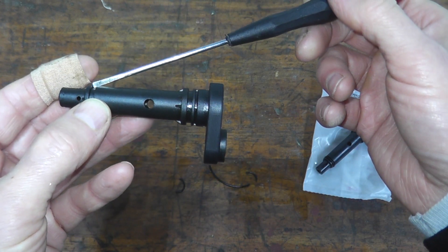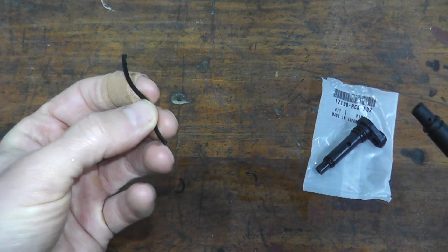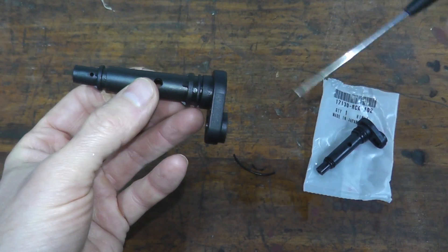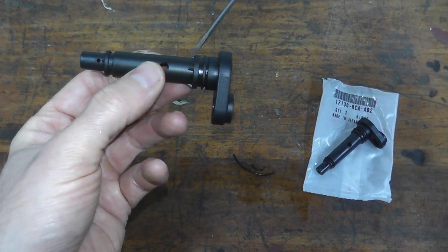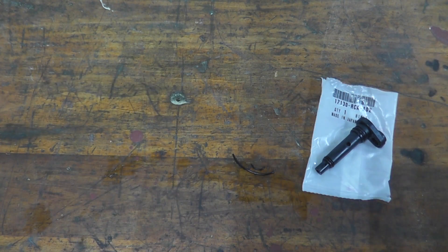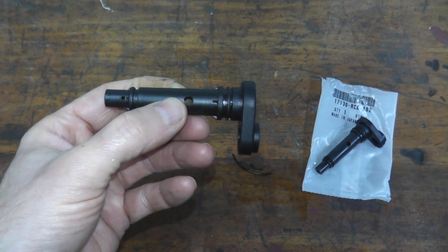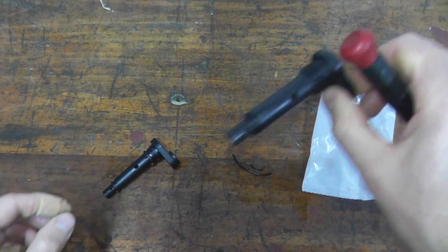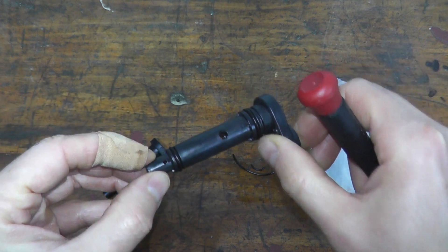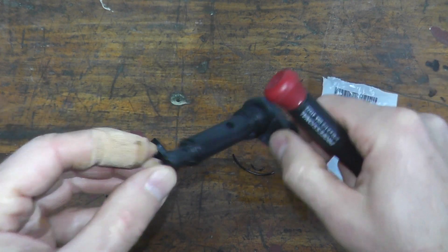Two and a half years later, maybe 20,000 miles in, what's happening is you have two o-rings — one here and another right here. I did remove them, and as you can see they're shot — completely destroyed, turned to plastic, no longer rubber. The oil is passing both o-rings and leaking onto the hot engine, burning off and leaving residue caking up on the front wheels. Pay more for the factory part — this is something that won't fail for many years. That old PCV valve was still in good shape at 13 years old when I replaced it.